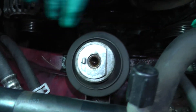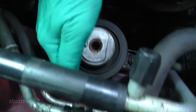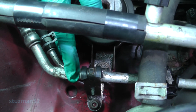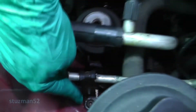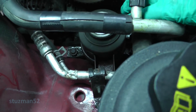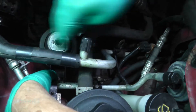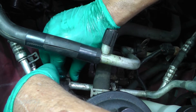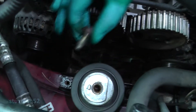What I'm going to do is take this engine mount out — this is not in the service manual. It's going to be three bolts, and a 13 millimeter socket will take care of it. There's one, one over here, and one right up here. But before you can get to that top one, you can see these two lines are over top of the bolt. Come back on the back side and you'll see two straps for these lines connected on a stud — a 10 millimeter socket handles that. I've already loosened them up, so let me take them out.